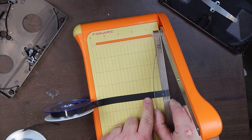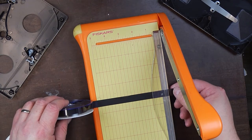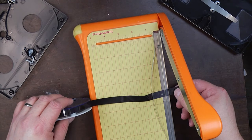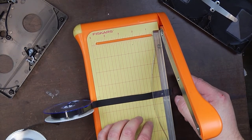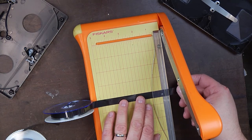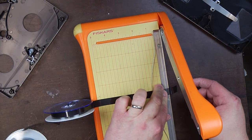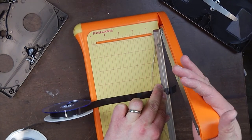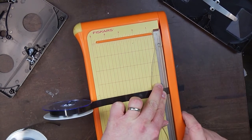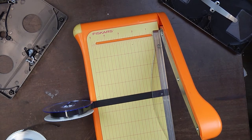You could wear gloves. I'm not too concerned with this particular tape because it's already in bad condition — it's really not going to get much worse, and I just need it long enough to get a capture off the tape. I'm going to pull just a tiny little bit of the tape out and use the guides on the paper cutter to line this up, with about an inch hanging off the side. Now I'm going to push down on this little guard to pinch the tape in there, take the handle, push it in as I push it down, and do one nice quick swipe. Now we've got a nice clean cut — a minimal piece of tape has been cut off — set that to the side.